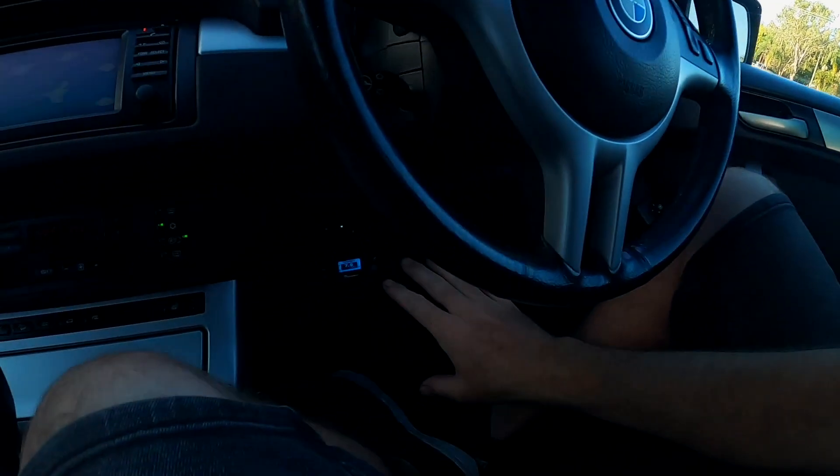I just got back from the drive. I was playing with a couple of the boost settings, and with it on no boost you can't really feel the trailer — it works perfectly, I think. However, when I start adding the boost, you can actually feel the trailer slowing down faster than the car, which is good. But we're not getting that instant lock-up which I was expecting. I had electronic trailer brakes probably 15 or 16 years ago and you could — it would jerk the car, they were super aggressive. I'm not sure if this controller is because it's one of the G-meter ones — it's a bit more clever.